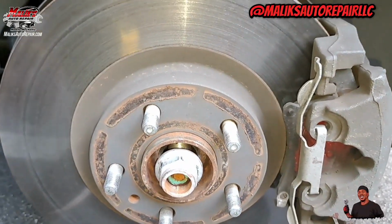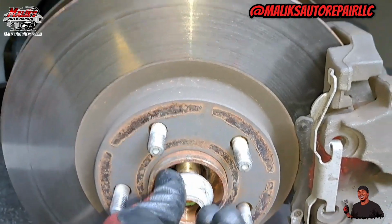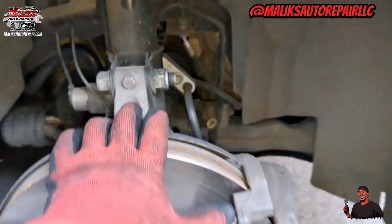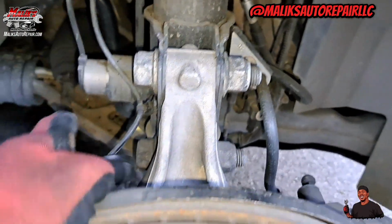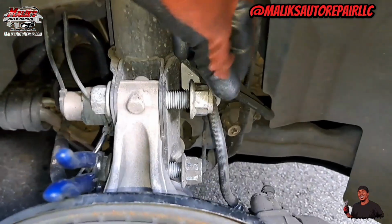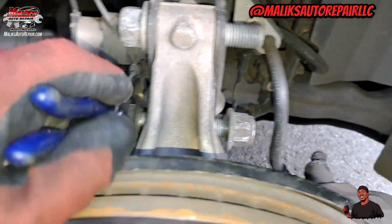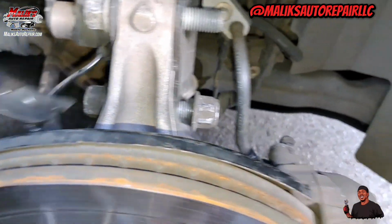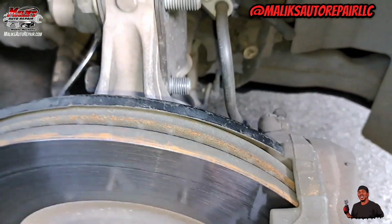See, I got that axle nut. That's a 32 mil. Get that off. We're gonna work with these here. Get them out. These are 24 millimeter nuts. Got my channel locks holding them on that backside so it don't spin. Now we can knock them out.